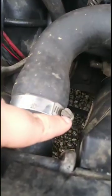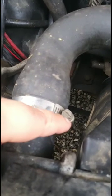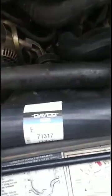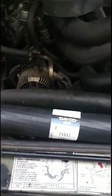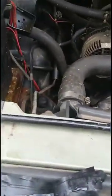Along with this, you can use a screwdriver to get this off. Now the other things I've got, other than the pocket knife and some tools, is the hose replacement itself, and I'll show you that as well. My truck is a 1994 F-150, and for this particular truck, this hose was 13 and some change. Let me make sure I got that on the right way. So here's the old hose. Here's the new hose. So let's go and find some tools and see if I can get these old clamps off. And as long as I don't break them, I can reuse them.